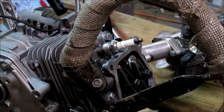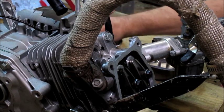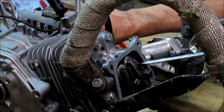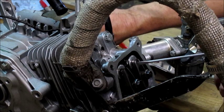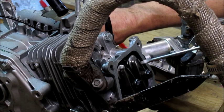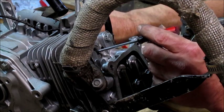We're going to take the valve cover back off and the spark plug out, and we're going to try and find a rough approximation of where top dead center is. Right now it's on the intake stroke — the piston is going down sucking air and fuel into the cylinder. It's coming back up, the rocker arm is back up in its closed position, and it's now on its compression stroke.